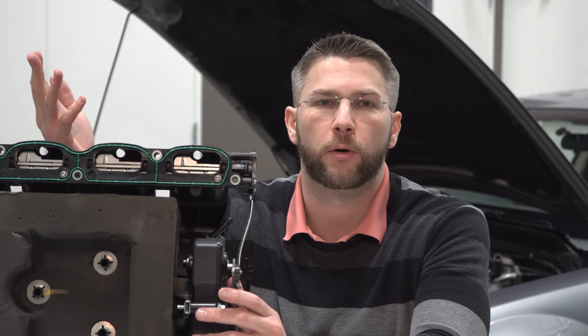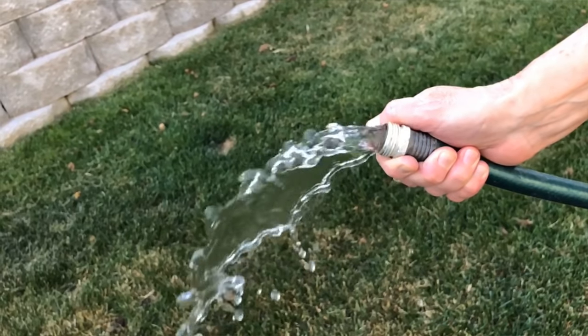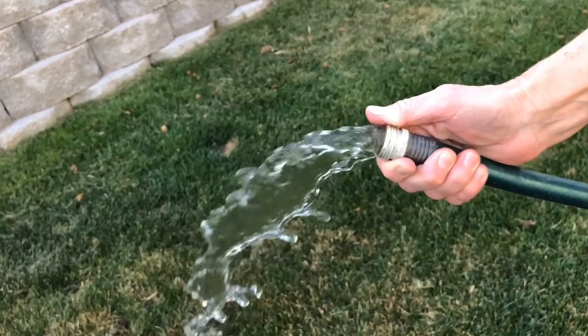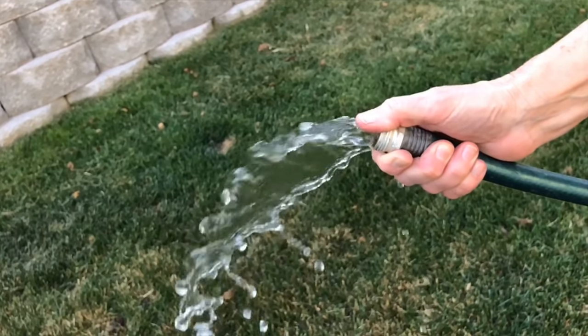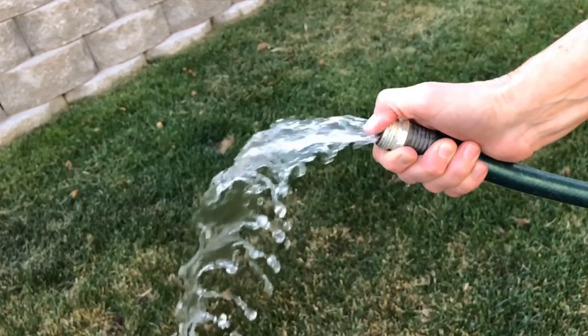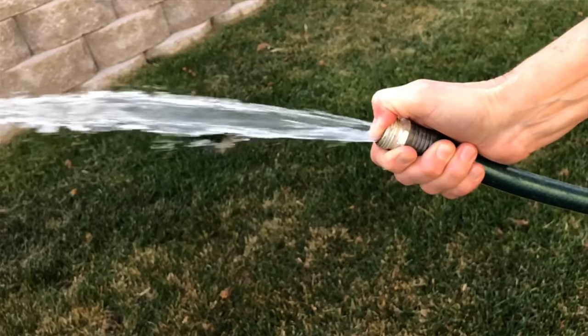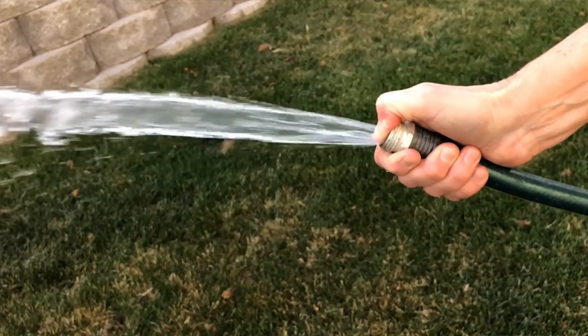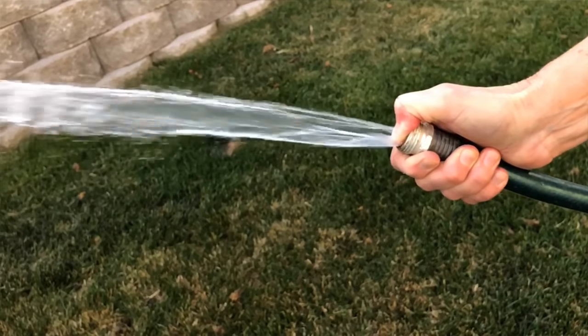Effectively what this is doing is increasing the back pressure in the intake manifold, and thus increasing the speed at which air will come through by decreasing the diameter. This is equivalent to whenever you've watered a lawn and you had a hose with poor water pressure — what would you do? You'd slide your thumb over the nozzle, thus increasing back pressure in the hose and the pressure differential between inside the hose and the outside air, and that would make the fluid come out at a higher rate of speed, increasing the surface area of the lawn you were able to water from a single point.